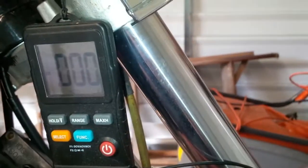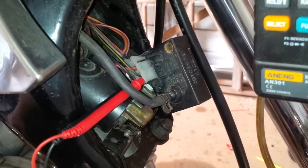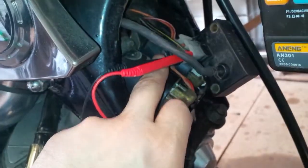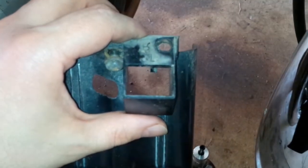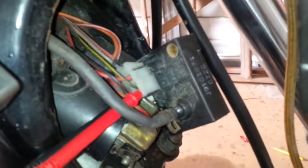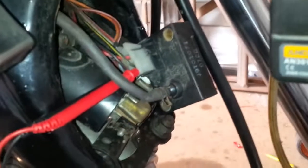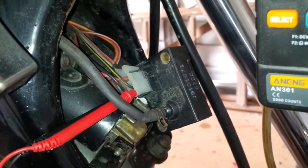That's what it does and that's how to test it without taking it out of the bike. All you have to remove is the plastic cover with the screws — the cover that covers the ignition coils. The boost sensor sits in a square cutout where the white plastic connector slips in, secured with one screw in one of the corners. That will be it, guys — hope that helps, have fun.